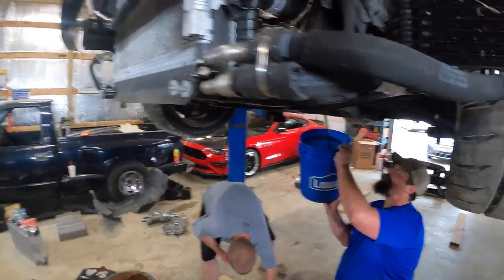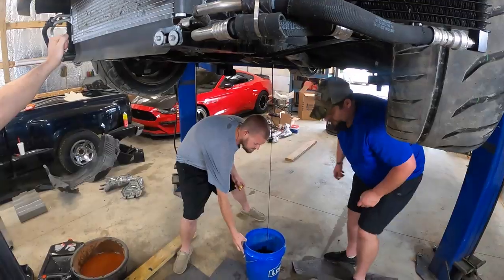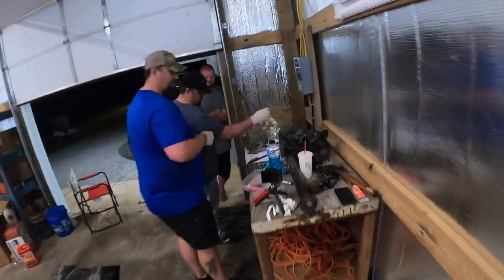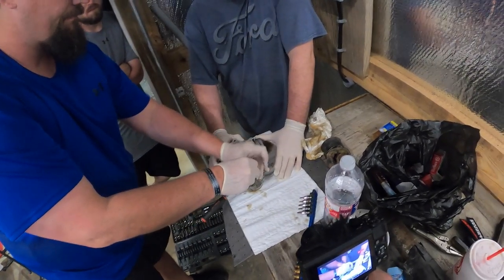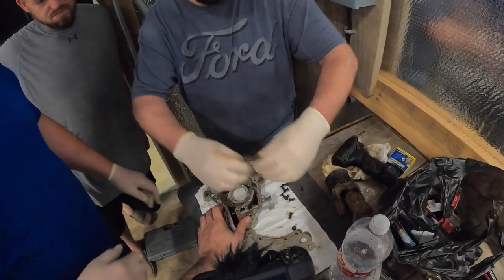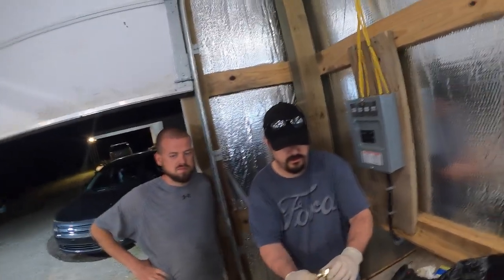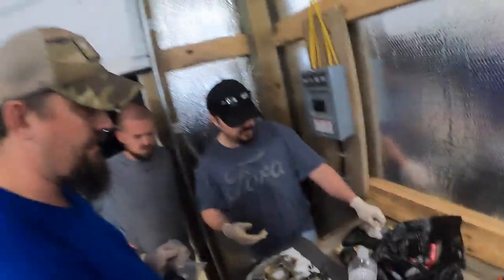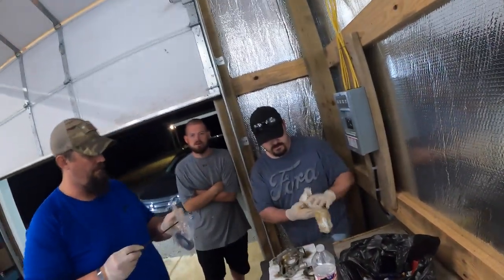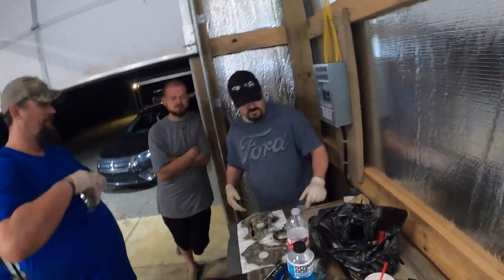If it's your car, that's unfortunately — we'll just say unfortunate, for monetization. All right guys, oil pump is out. Pretty easy — we fought with one oil pan bolt for about an hour, but no big deal. Jack is actually going to be dissecting his oil pump here, so he's pretty excited. Best thing to do is keep the tools straight up and down and take your time so you don't strip these out. So they interlock with each other. We actually put in new revised gears — they're sleeker but higher strength. The stock ones will crack and break, and then you lose oil pressure. The stock ones are really good for the RPM the engine is factory tuned at, but above 600 horsepower this is arguably 100% necessary.